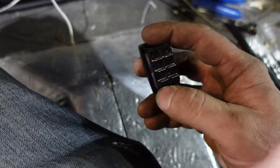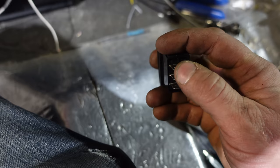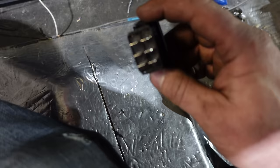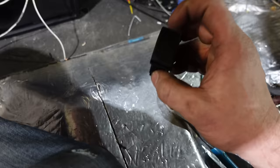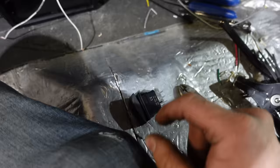My rocker switch is essentially two switches — this bank is completely separate from that bank. I need to jump power from one switch to the other. I only need to use one bank, but they need to be separated because I want to raise them individually but drop them in unison. If I make them drop in unison I won't be able to drop pressure independently. So what I need to do is run two relays off of my door signal — that will separate the two — and then use the pressure switch for front and back. Then I'll figure out which wires are which by just touching positive to them.